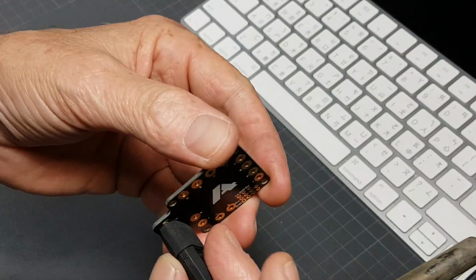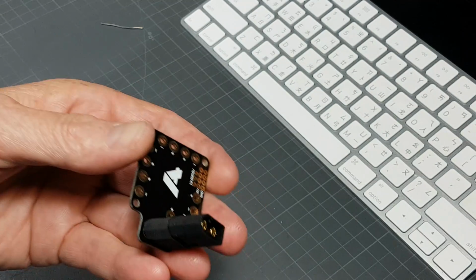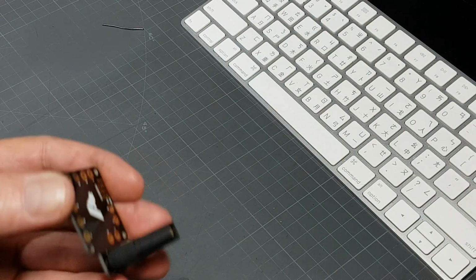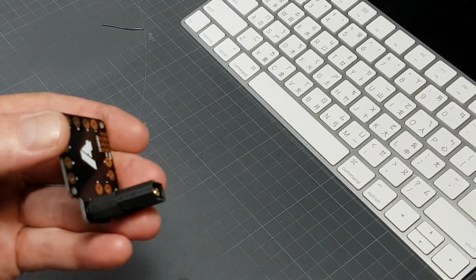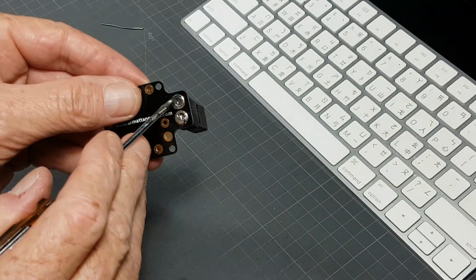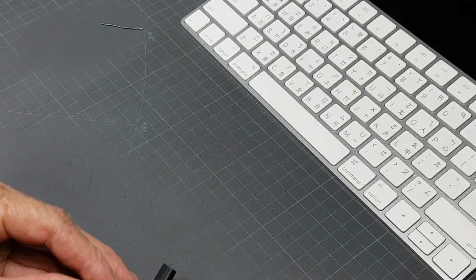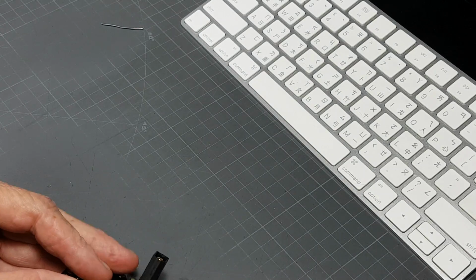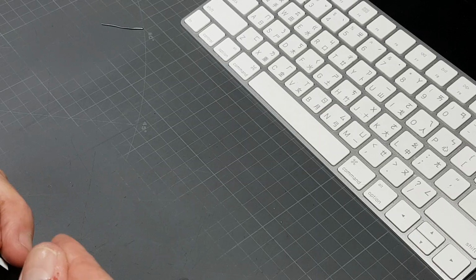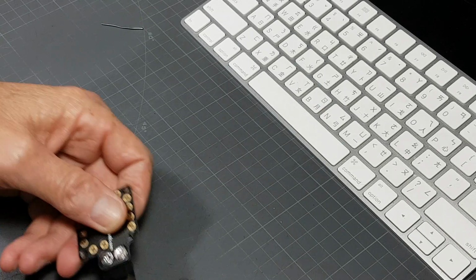Before I do, I make sure that my pigtail on the other side is lining up with the hole. In this case, I see that it's just a little bit off. I'm going to fix it because it's bent twice. It's bent now, right? So the wire is going to probably likely interfere with the outside of the hole. I'm just going to push that in a bit. Make sure it will line up nicely. There we go. And I go ahead and tag this side.